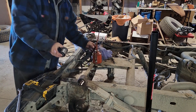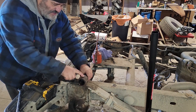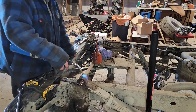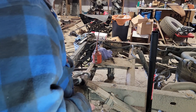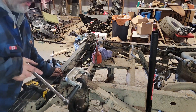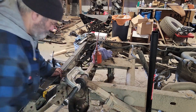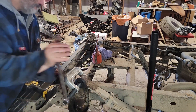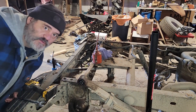So there's the new bushings — they go in from the inside out. It definitely is going to be a fight to get that to go in, but a little heat to expand it makes life easier — it's not even a necessary step. We're going to put this on the end, then this cap goes on here. Now it should self-center and go right in. Just like that. I love it when the plan comes together.